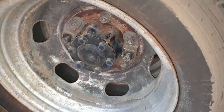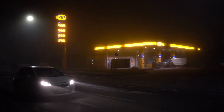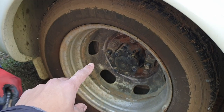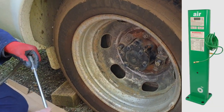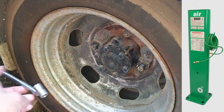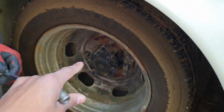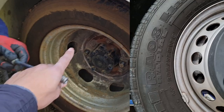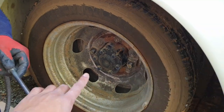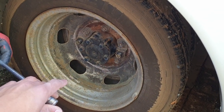Another thing to note: if you're going to a fuel station to fill up these tires — because they're like commercial tires — most places like BP or Shell, those air pressure fillers are not capable of going up to the pressure required. You have to go quite a bit higher, so check your manual. For this one you'd go between about 55 to 60 PSI.